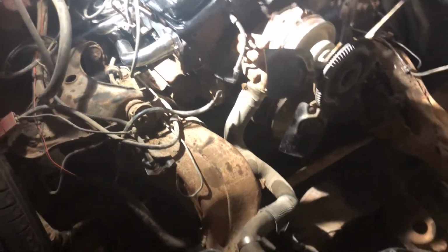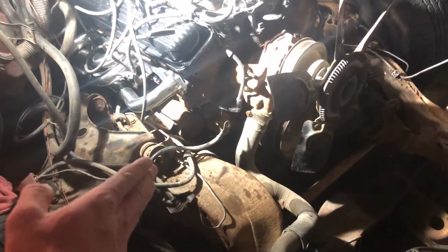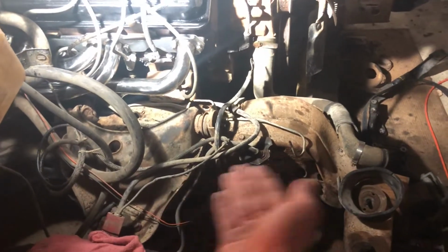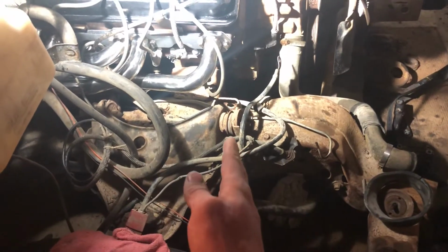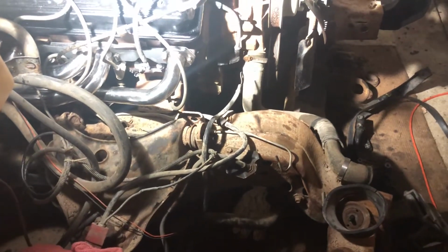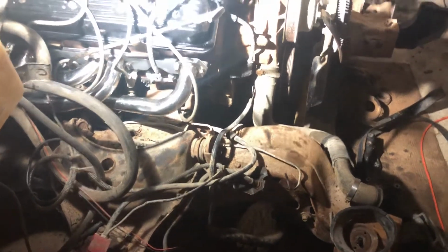So I'm going to be doing a Z-cut. I'm going to come down right on the front side of the control arm mount, come back to where the crease ends, or as much of my new piece as I have, and then back down. That'll create multiple shear planes, will give me more surface area to weld to, and will ultimately just be much stronger.